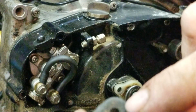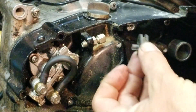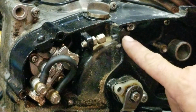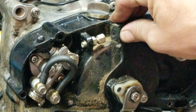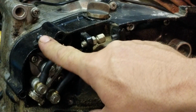And now your cable's through here on this side, and your hose is right where it was before. That's going to fit there. So now, you're blocked off here. No debris can get into the carburetor section, and you won't get a lean condition from sucking air. This side right here is now water resistant, water free.